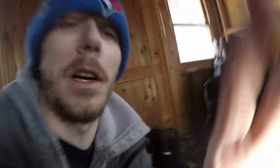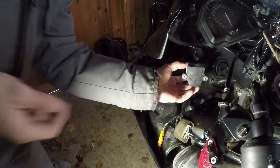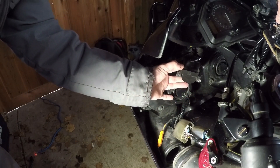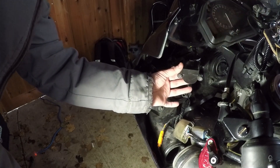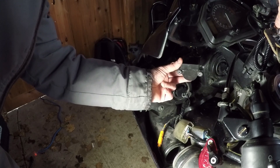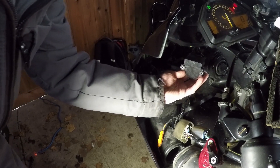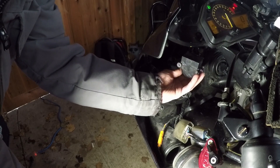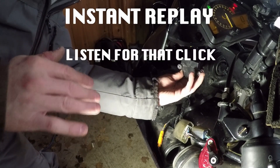With the ignition off, when you got everything in the run position, with the bank angle sensor still plugged in and your ignition off, you're going to hold it so the arrow is pointing straight up. Then turn the ignition on. This is a very basic test. I know my engine relays work — we tested all that in parts one and two. So I got the bank angle sensor up, I turn the ignition on — A-OK. Now what this test consists of: if I turn this to simulate a tip over, where the arrow is pointing more towards the ground, my engine stop relay should make another click. That's basically turning it off, and my bike — if it was running — would just stop right then and there.